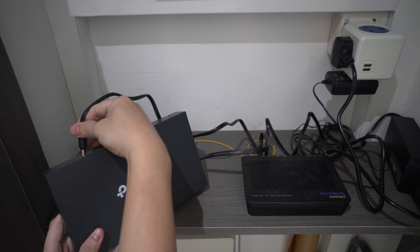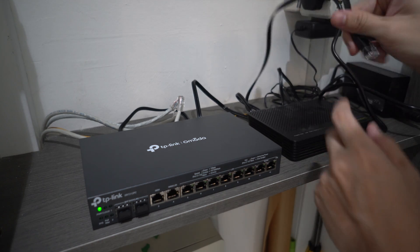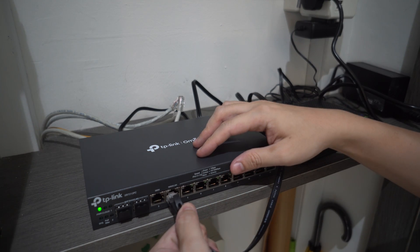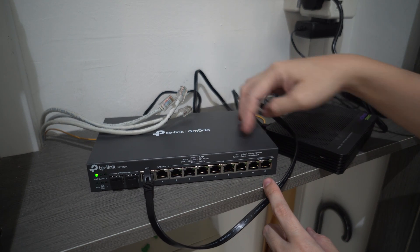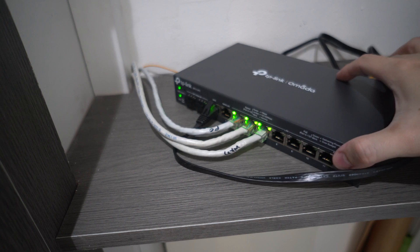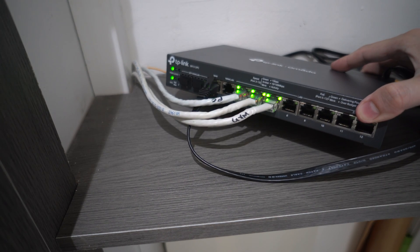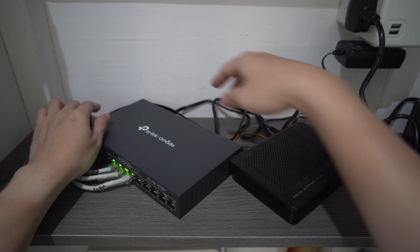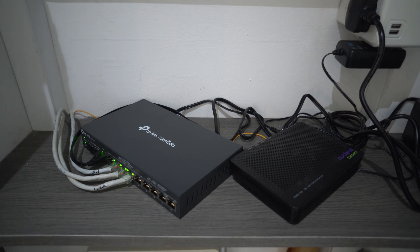Inside your DB board, you will place the 3-in-1 router. If you prefer to mount it on the wall you can also do that. Take the cable from your ONR or ONT and plug it into port 3, which is the WAN port. Then for all your rooms you have ports 5 to 12 — a total of 8 ports to use. A few minutes later you will see the lights blinking on the ports you've connected — blinking means there is activity. Everything should be okay and you can go ahead to configure your Wi-Fi settings.